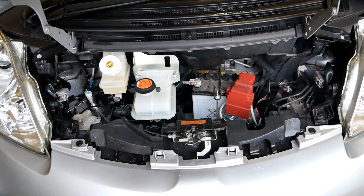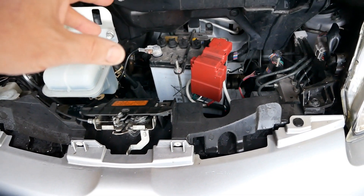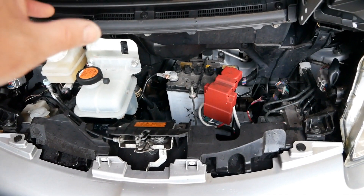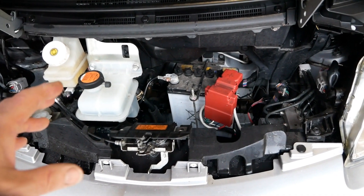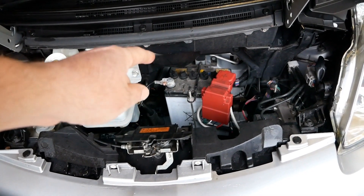The 12-volt electrics and your 12-volt battery — obviously all electric cars have a standard 12-volt battery. The big traction battery, which is typically 400 volts and sits under the floor, powers your electric motor and heater. Everything else in the car — the headlights, the dash, the wipers, and all the ECUs — is driven from the 12-volt battery, just like a normal petrol or diesel car.